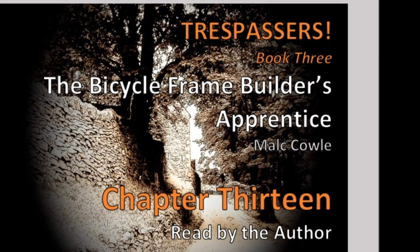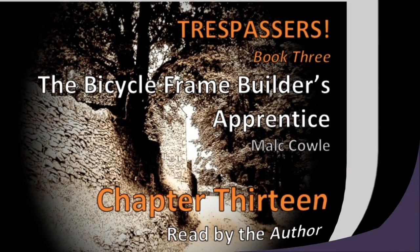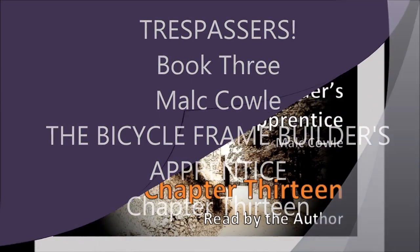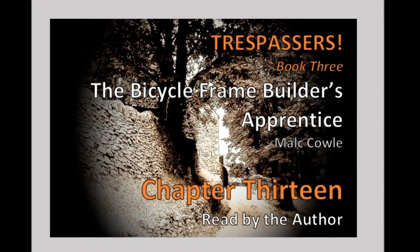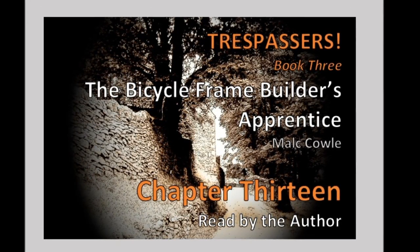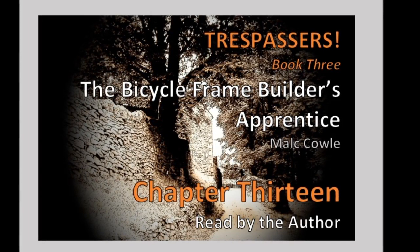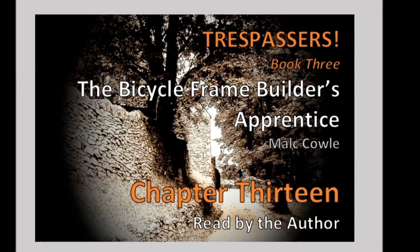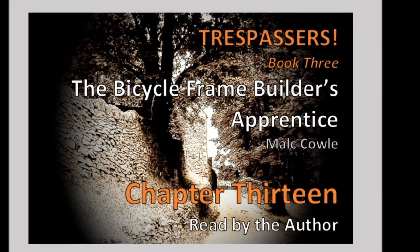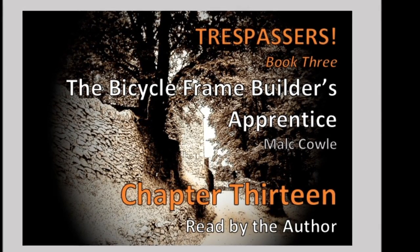"It looks as though it's full of rust." "No, Conny, quite the opposite. It's copperslip grease. That's why it's a golden-brown colour." "Copper slip?" She looked up at him, her green eyes asking the question. "Yes, it's usually used on the seat post. It prevents aluminium bonding to steel by introducing a third metal, namely copper. That prevents the electrolytic action between steel and aluminium, which results in cold welding. Some greases, like lithium grease, which is used to lubricate bearings, tend to promote bonding. Then you end up with a seized-in seat post, which isn't a good idea."